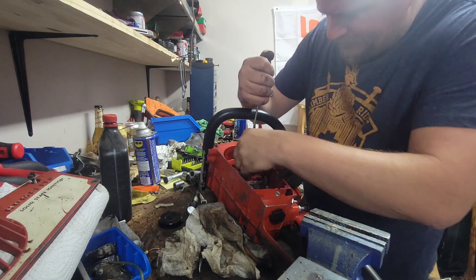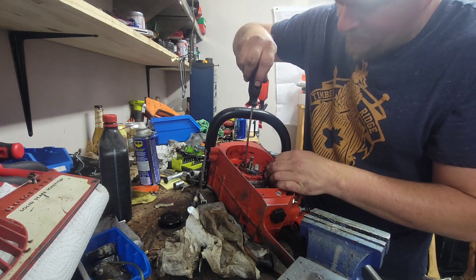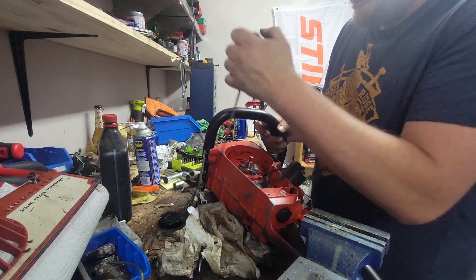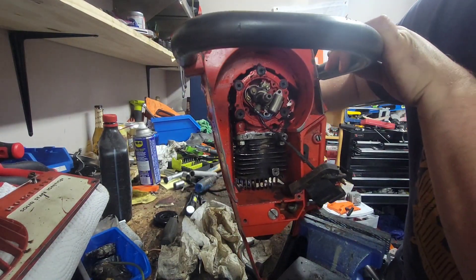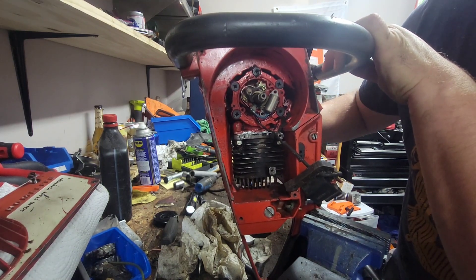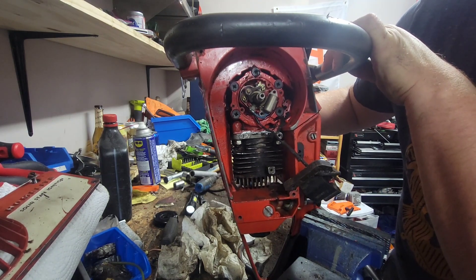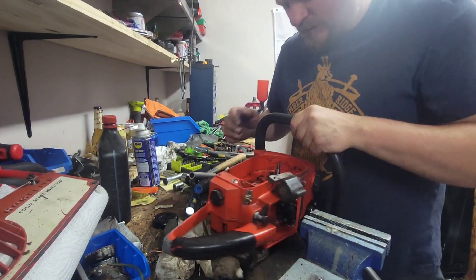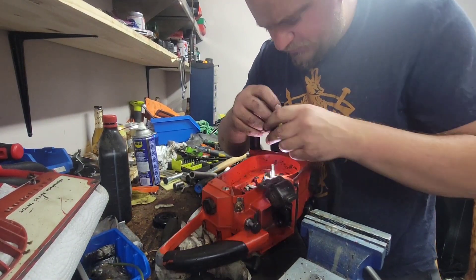The stator plate should be completely counterclockwise, I do believe. Tighten it down there and just see if the points do point things. Checking the gap with a feeler gauge - that's a 15 thou gap but it looks like more than 15 thou - looks like almost a 30th of an inch.